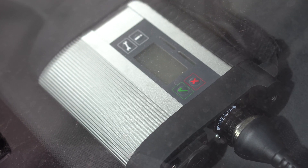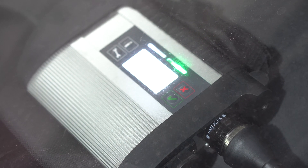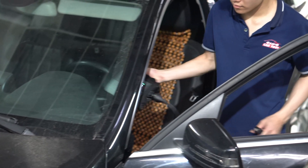Connect the C4 to your car with an OBD16-pin cable via the OBD connector in the car. On device C4 you can easily see the successful connection signal. It is located here. Connect C4 to the laptop with LAN cable.